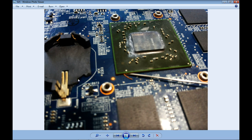If you reflow the whole motherboard in a specially engineered process with controls, it should be well done. Some of the connectors and plastics are for high temperature, and others are not. They didn't use enough temperature to melt all of them. But the CMOS battery housing has two leads that you have to solder with a pen soldering iron, so the hot tip comes here and doesn't expose the rest of the plastic to it. And this plastic is breaking like a cracker. So it tells me the whole board was overheated.